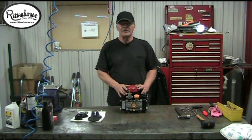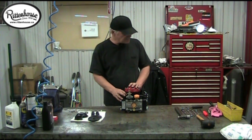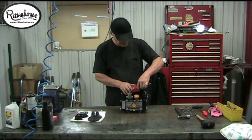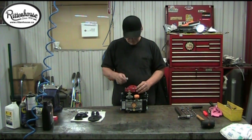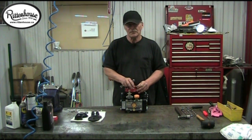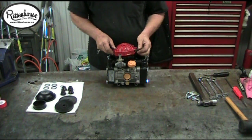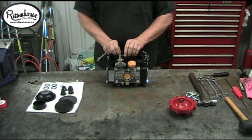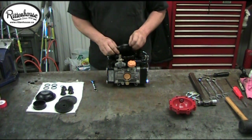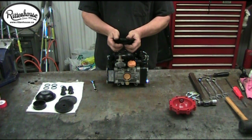The first thing we're going to do is take the top off the D30 — we're going to take off the air chamber accumulator housing. The wrench you're going to need is a 13mm. Loosen off all the bolts, pull them all out, take out the last bolt, and take the top off, revealing the diaphragm.